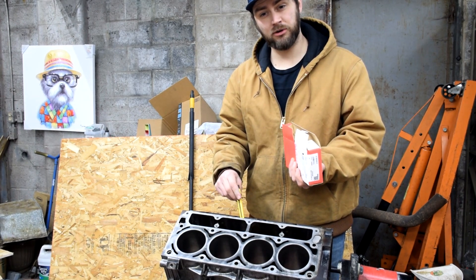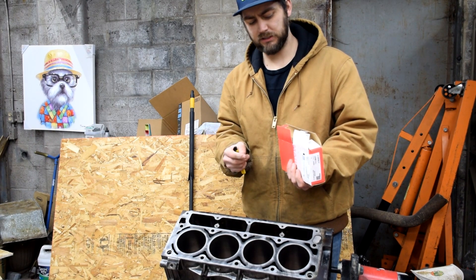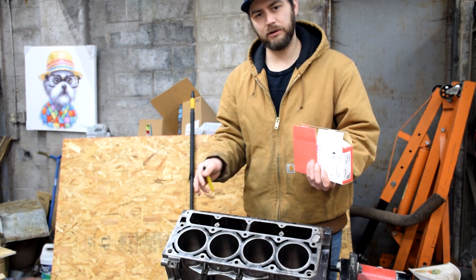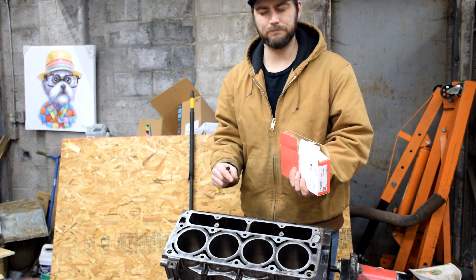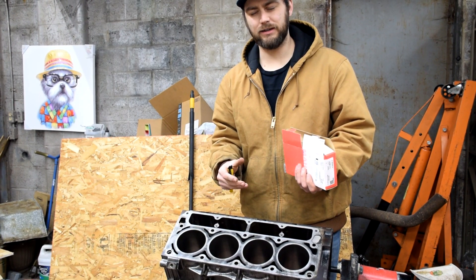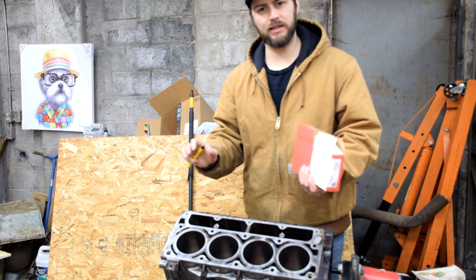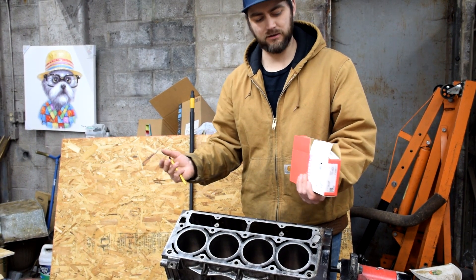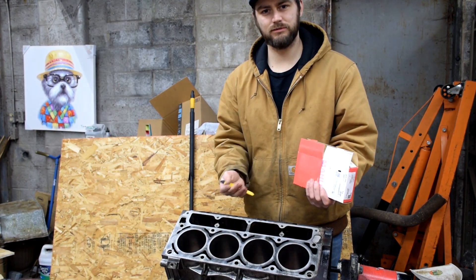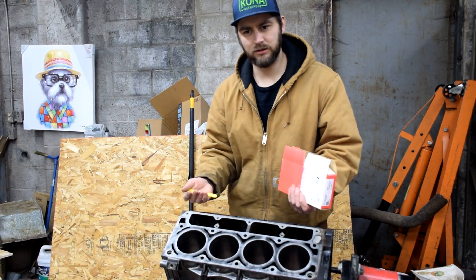I won't be pushing high horsepower or running a full race motor. But if you're just doing a street rebuild, these are good enough. If you're doing a full race motor, you might want steel rings with a special coating — they make all kinds of rings. You might have to do something exotic, but it's going to cost more. These are pretty cheap; two boxes are cheaper than really high performance rings, but there are trade-offs.